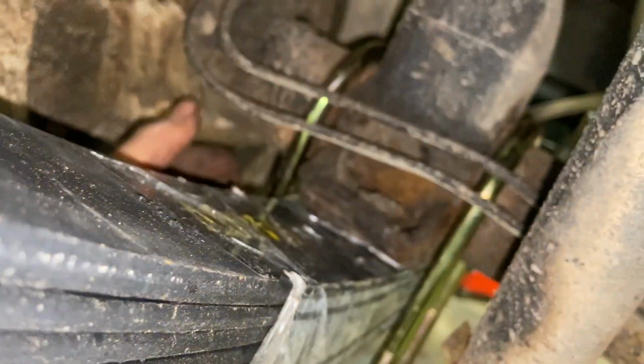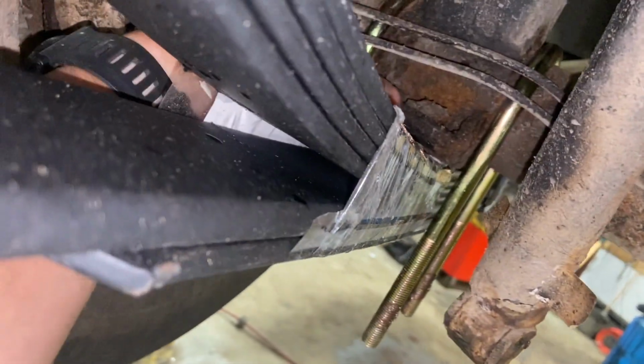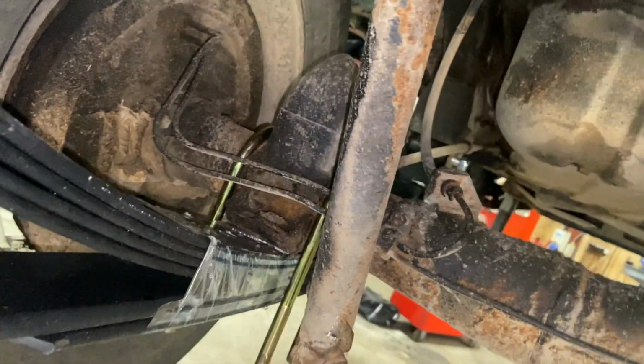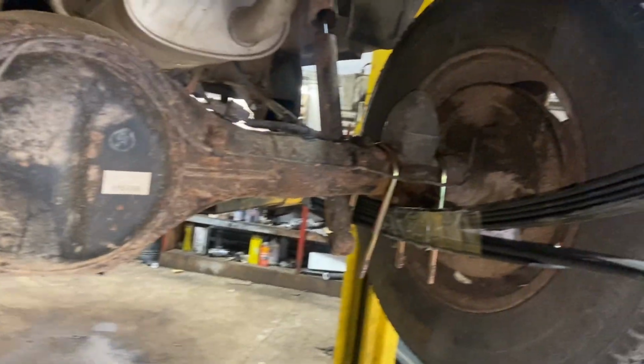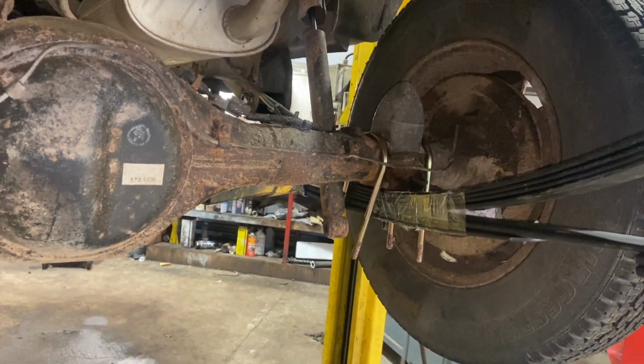So just simply drop that in now, and just see it's landed nicely in place, it's nice and solid there. And we put the brackets on, clamp it up, it can't physically move at all over the leaf spring as well, so just run them up now. All four bolts either side, they don't have to be mega tight, but they do want a good nip.